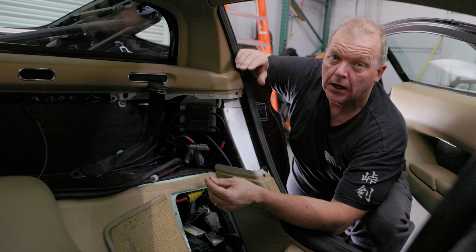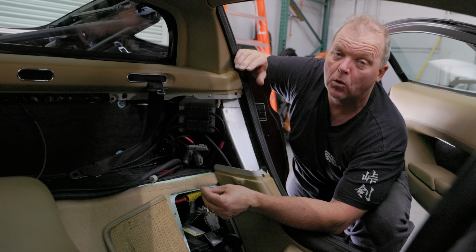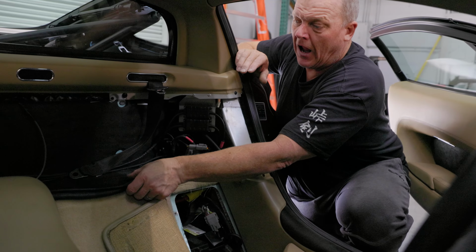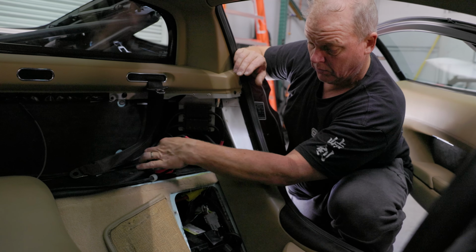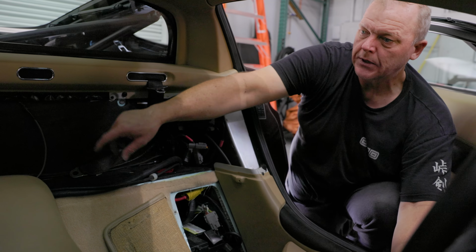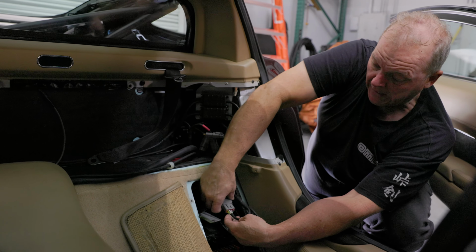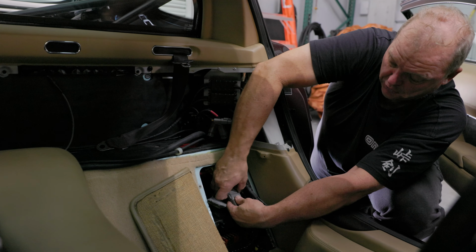And the only other plug that exists aside from those two big plugs is the main power wire going to the battery to the starter motor. So in that case, everything for the ECU is run through these two looms that you can see right here. Now these two looms go over there to the passenger side of the car. And then the stuff for the actual gauges, all of the gauges are in this Deutsch connector here.